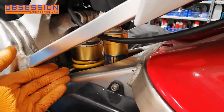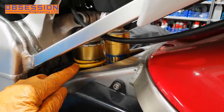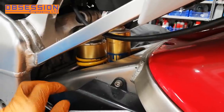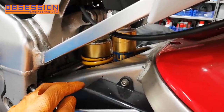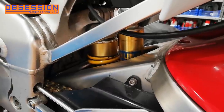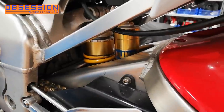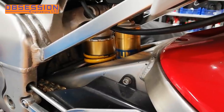Setting the rear shock is actually a little bit easier than doing the forks because of course there is only one of every adjustment. I have also managed to find written on the spring that it's an 85 newton per millimetre spring, which is about what I'd expect on a shock for road use in a modern Japanese motorcycle. It is written down here behind the swinging arm — quite well hidden — but with the joys of a mirror on a stick and a torch I was able to find it. So I know that's somewhere in the right region, and it makes me positive that the front is probably somewhere near as well.